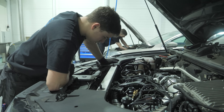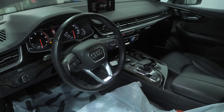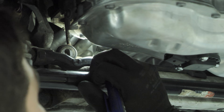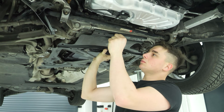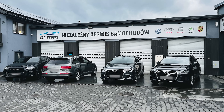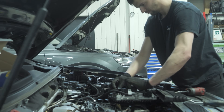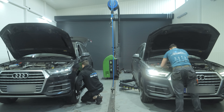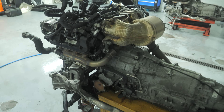We will also check the efficiency and operation of the exhaust gas treatment system and many other parameters. When we return from the test drive, we once again carry out a check to ensure that everything is in order and that no leaks or faults have appeared. We put on the previously cleaned underbody covers, and finally we wash the car. We can now invite the customers to collect the cars. The entire process of replacing a 3.0 TDI engine takes two days, and we replace engines in two cars at the same time.